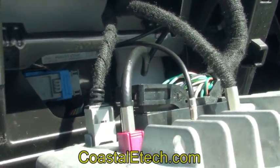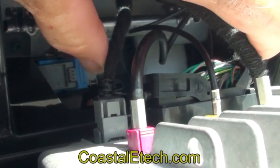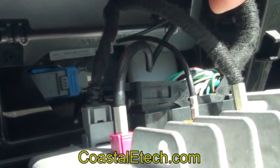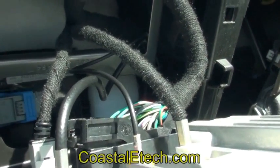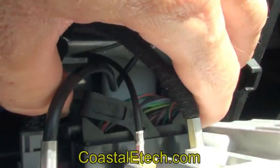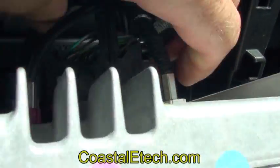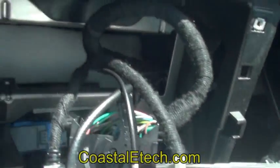To remove the rear connector from the screen, it's really easy. You're just going to squeeze the connector itself and pull in on the end. When you squeeze it, it will release a tab — lift the tab up and that will drive the connector directly out of there. And just like that, it's loose. Now we're going to plug that directly into the Lockpick connector.